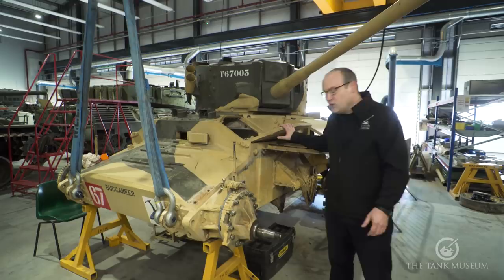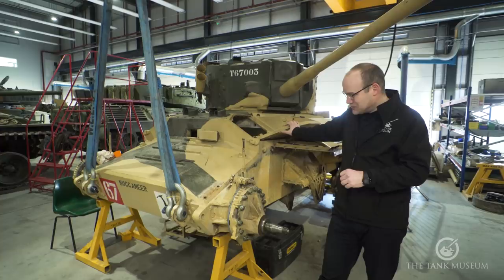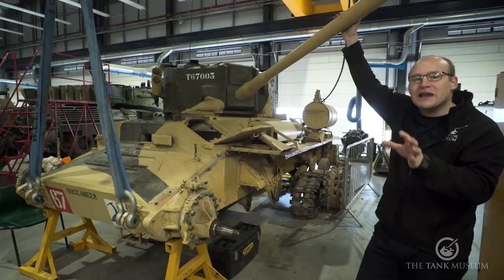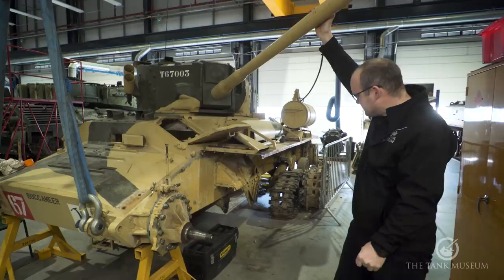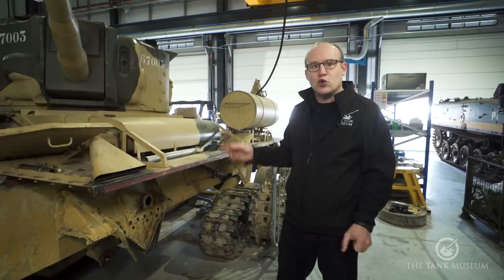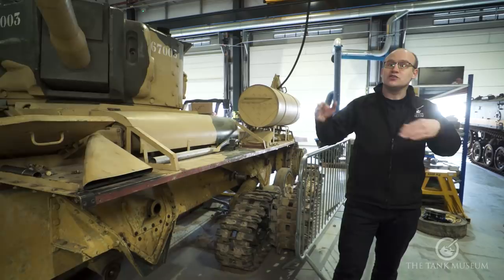Looking at the Valentine — a few years back we did the engine and gearbox, what we call a systems overhaul, and we always said we needed to get back to the suspension because it was very worn out. As you can see, the vehicle is trussed up and we've taken the front suspension units off. They were completely worn out. The units on both sides, left and right, are removed; they're still in place at the back. We've got quotes for bearings and are now waiting for parts.